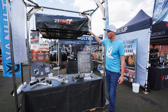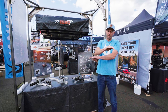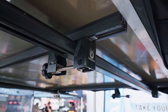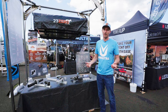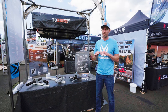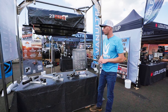The other thing you'll notice is that these mounts are low profile. Instead of mounting on top of your crossbar, they mount below the crossbar. A lot of options on the market mount at the top of the intersection and space the tent up — typically an inch to an inch and a half, sometimes two inches. We didn't want to space your tent up, so we spent the time to figure out how to keep your tent as low as possible and keep it low profile down to the roof of your vehicle. So we mount below the crossbar to keep it real low profile.